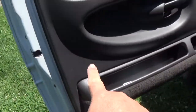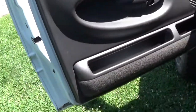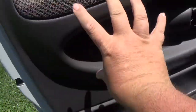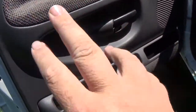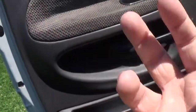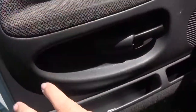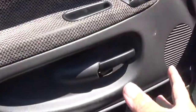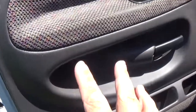If you see, there's an outline all the way around here. Now, thinking about making a mold, even down in here, so our mold will be of this. Probably 2 layers of fiberglass matting. Then we can peel it off and do what we can do. We'll sand it smooth. We'll probably paint it the purple metallic like we did the headlights and everything like that. So we'll probably do that.